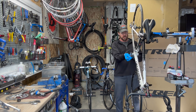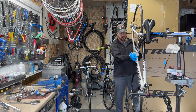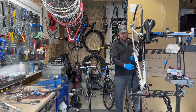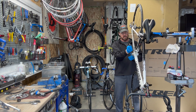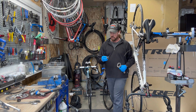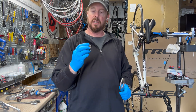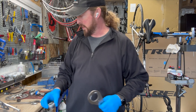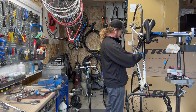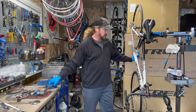Sometimes bottom brackets get pretty tight in there. I'll put a little tap so I can get it started to loosen up. I'm going to move my tool to avoid bumping into the derailleur. Forward to loosen backwards. There will be a mark on these external cups — it'll say tighten with the arrow. That's how that works. Then do the other side the same thing.